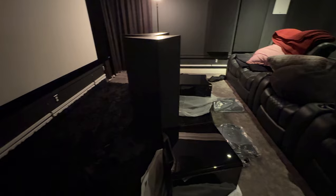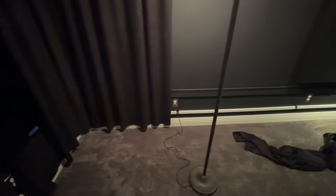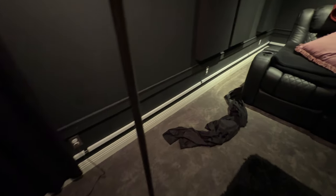Here's a view of everything with the curtains down. You can see that hole in the wall goes through behind my AV rack. The white channels carry cables: speaker cables, HDMI, and ethernet to the JVC projector, and XLR to the subwoofers in the back. One cable has already been run there because I put one Arendal in the back some time ago. I pulled the lower curtains down but I'm not going to pull the upper sections — those I can just lift up and work behind. I may have been premature about buying those extra channels; I think I can just get the subwoofer cable into the existing channels as they are. As we come across from the front of the room, speaker wire for all seven base-level speakers comes through there, along with the XLRs, HDMI, and ethernet.